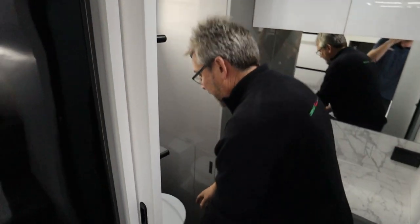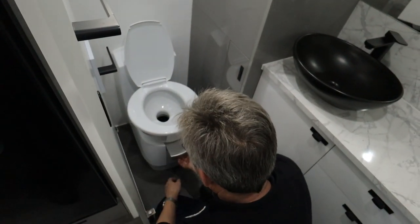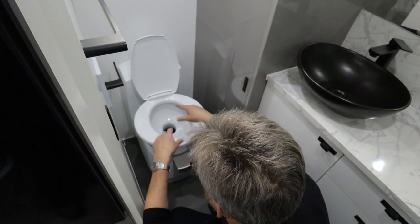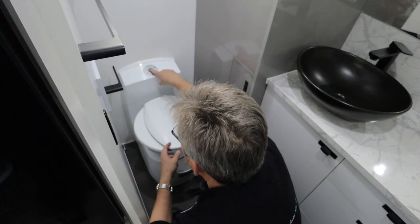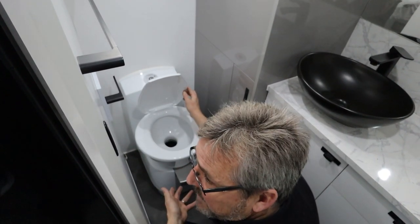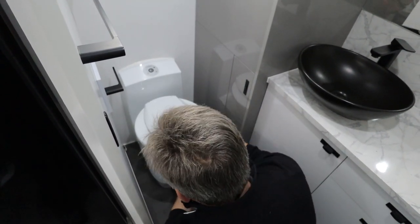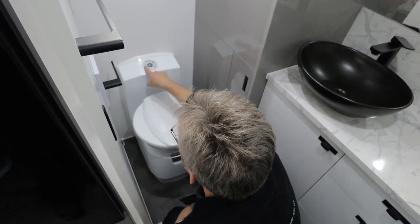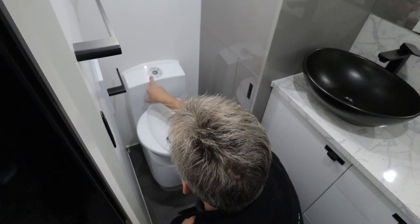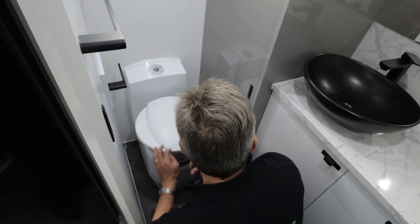Your toot is the thing that everyone wants to know about. Open the lid, open this grey handle - that's access to your cassette. That's where you put your chemicals, that's where you put your waste. The middle button will flush as long as you hold it down, either out of your tanks or out of mains pressure - there's no separate filling tank to flush with. When you're done, shut it off. Follow the magic lights because it'll tell you when the cassette's out, it's not sensing any flushing water, or you're three-quarters full. Keep an eye on that.